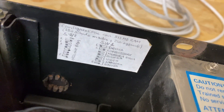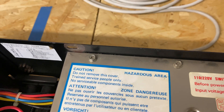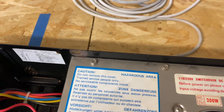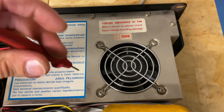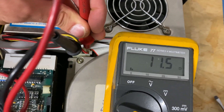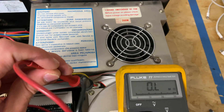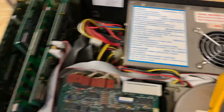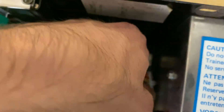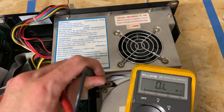We also have some notes — interesting. '512 megs.' Somebody definitely did a typo because this cannot have 512 megabytes of RAM. So, we're going to stick this thing into the ground. The yellow rail is already shorted — that's the 12 volts. And about 11 ohms on the red, which is 5 volts — I think that's fine, there's plenty of logic in there. But we have a short on the plus 12, definitely. So, let's start unplugging stuff and see if the short is on the main board. I'll disconnect the two main plugs going to the mainboard, so now we only have power to the floppy drive and the hard drive.